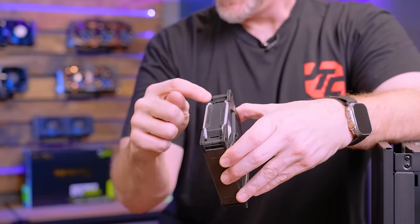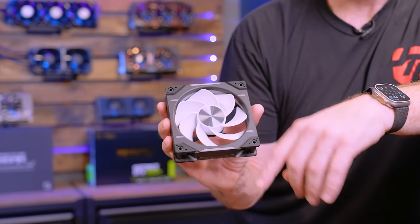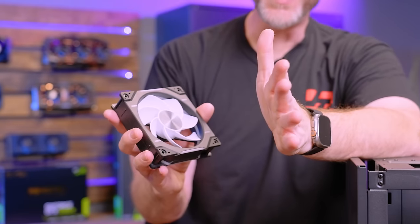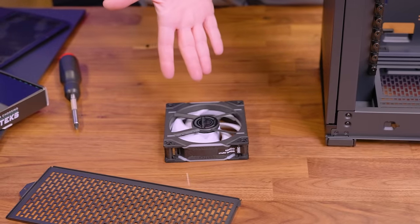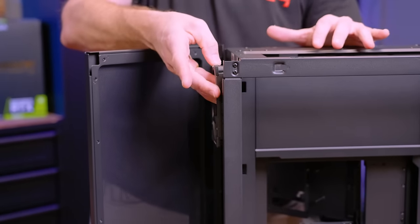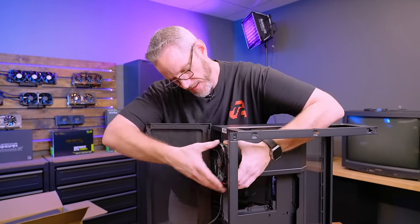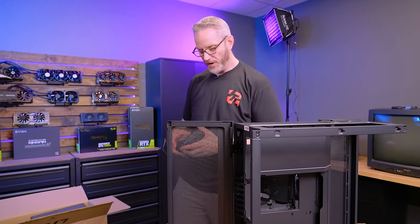This is actually one of their 30 mil reverse flow fans — the D30 fan. Check out the fan blades: this would be nuts for static pressure because they are so aggressive. Normally the fan blades are pushing the airflow out the cage side, so reverse flow just means it's pulling in through the cage and exhausting that way. That way if these are on the bottom, it's a lot prettier to look at. There is no way a 30 mil fan is going to fit in this — not even close. So this is a regular old 25 mil fan from another brand. You absolutely could mount a 25 mil fan on the outside, two of them, and then have the rad on the inside, or it would allow for push-pull if you had interference with your motherboard.